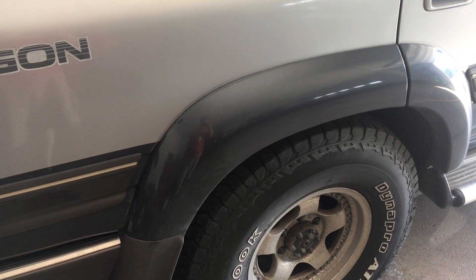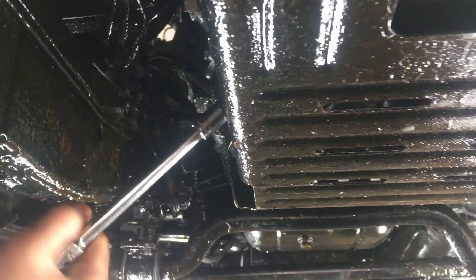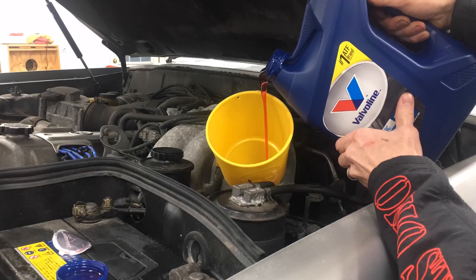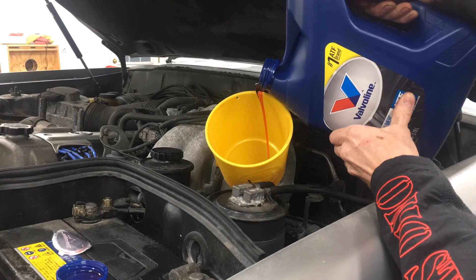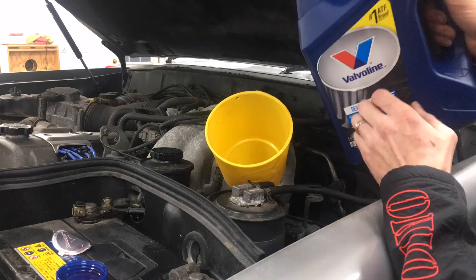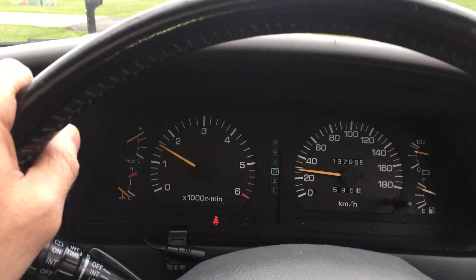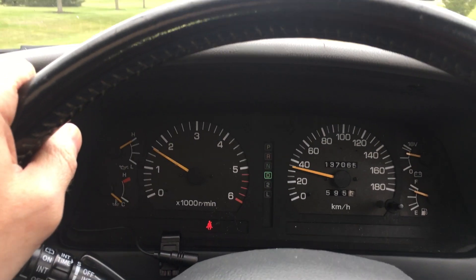The FIPG needs to cure for a few hours. Back underneath, make sure the tubes didn't separate and then put the lower bolt back in and reinstall the pan shield — 4 bolts. After letting the FIPG cure, I added 4 quarts of transmission fluid. I drained about 6 quarts, but 4 is enough to start the engine, get the vehicle on level ground, let it warm up for a more precise check — then I ended up adding about 2.5 more quarts. I went for a test drive and 2nd gear works again along with ECT and overdrive. Thanks for watching — consider subscribing for more how-to videos and project vehicle updates here at the 6th Gear Garage.